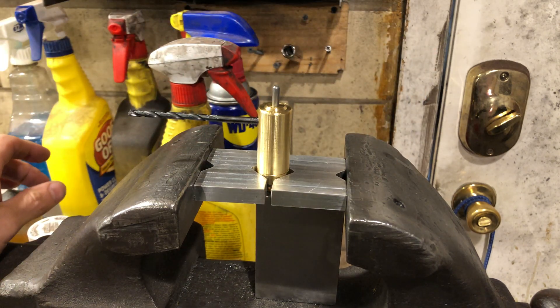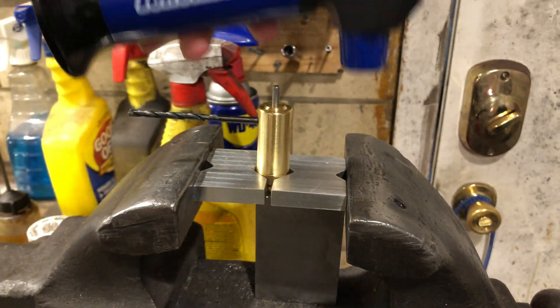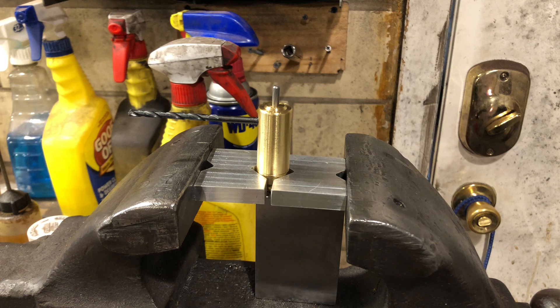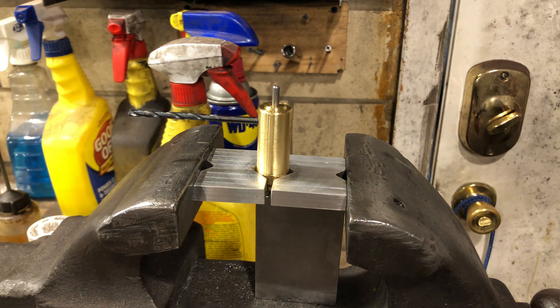For the ones that you can't, or that are a pain in the butt, use a little bit of heat from a butane torch — just a little bit. It doesn't take long at all. You won't melt the O-ring inside, you won't melt the little orange face seal. Just give it a tap of heat, about two seconds.